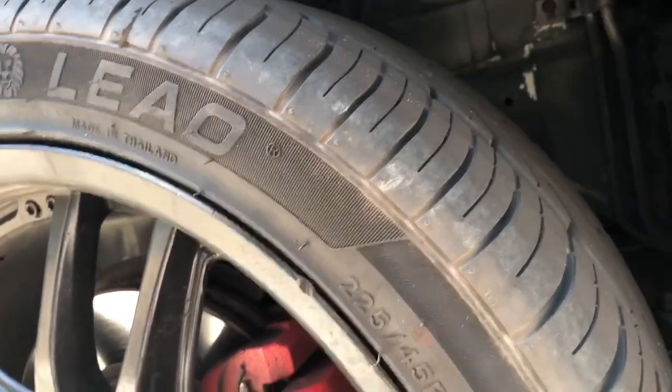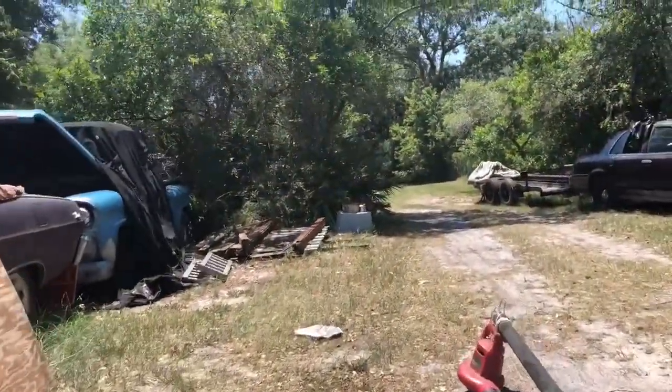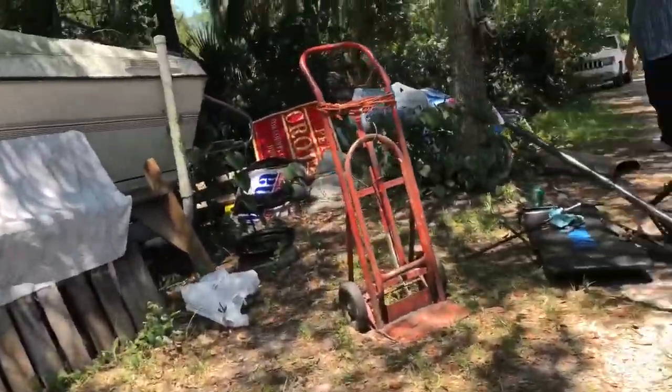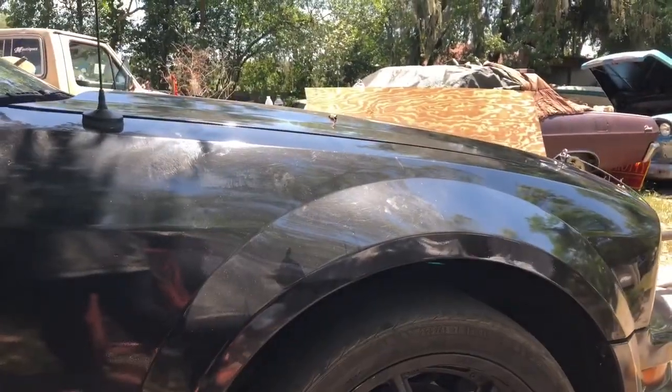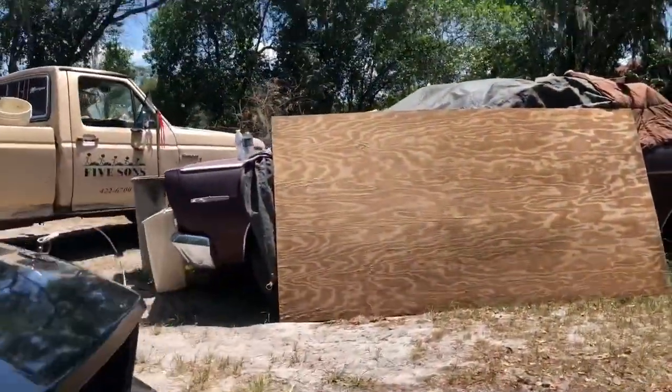And then all you do is let the other side down, which we're supposed to do with the other side down. It has to have the weight of the car on it, that's all. Okay, set it down all the way. So let's double check that one. You see what I'm saying now? Then you get both tires pointed in the same direction.